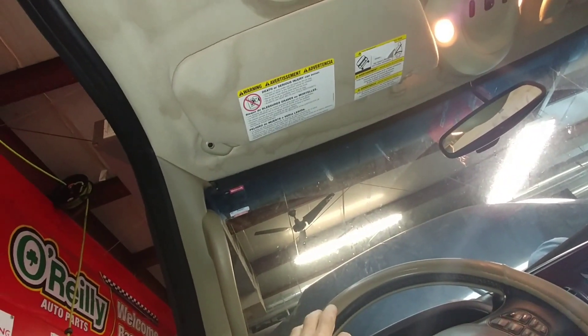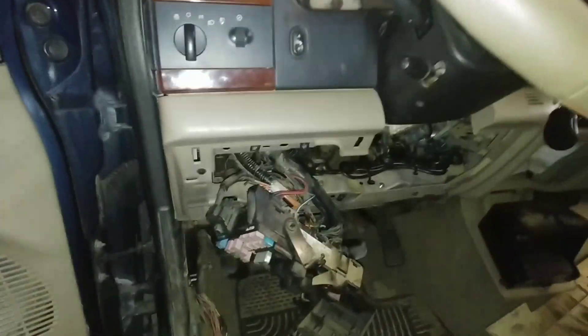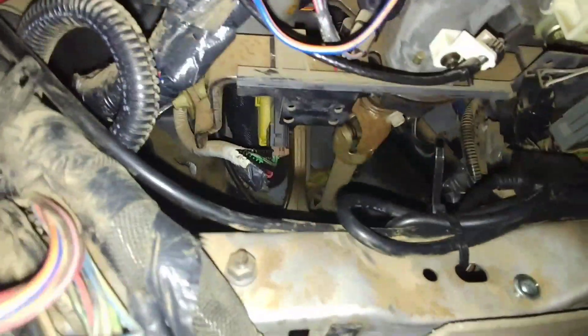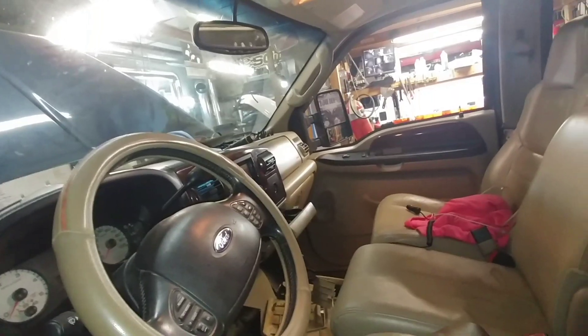Now what we've got — we did have a windshield put in it. Not really liking this staining going on right here in the headliner. We had a windshield put in it and it's looking like the windshield is leaking, possibly. So we're going to go ahead and have the windshield done again, have them check it. Right now it does not start when it rains. So what I was going to do was get everything exposed down here where I can watch under here, shut the hood, and just physically spray the truck with water and watch for where any leaks are.